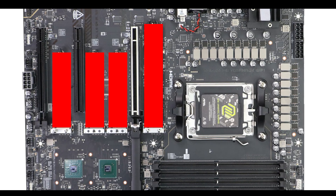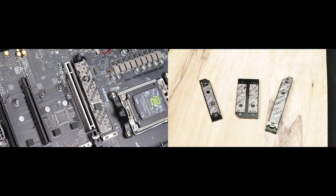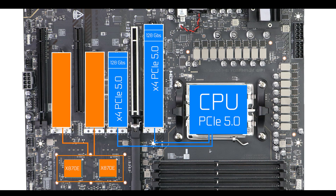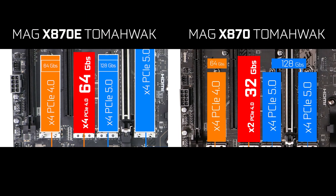Storage-wise, this is where we start to see the subtle differences between the MAG X870 Tomahawk and the MAG X870E Tomahawk. We have four NVMe connectors: two CPU-fed PCIe 5.0 connectors able to output up to 128 gigabits per second each. The closest one to the CPU receives the bulk of cooling attention — double thermal pads, floor and plates for immediate heat relief, plus the thickest thermal plates on the board. The two additional NVMes are chipset-fed and can output a dedicated, non-bifurcated four lanes at PCIe 4.0 standard each for a very fast 64 gigabits per second — something we simply could not do on the MAG X870 Tomahawk, which provided fewer lanes per stick and shared them with the PCIe exports.